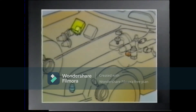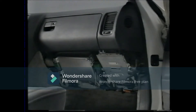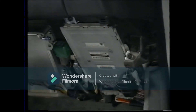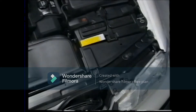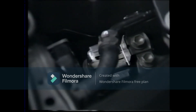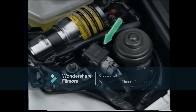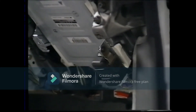First, the ECUs and relays. The TRC ECU is installed under the glove compartment at the right-hand side of the engine and transmission ECU, and forms a single unit together with the ABS ECU. The three relays that are used are the TRC brake main relay, the TRC motor relay, and the TRC throttle relay.